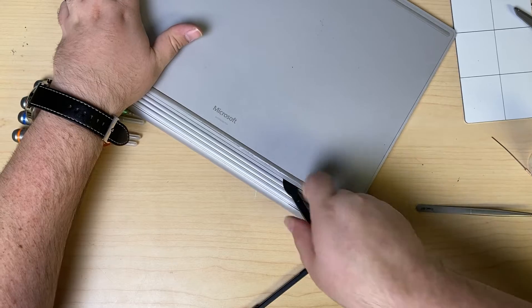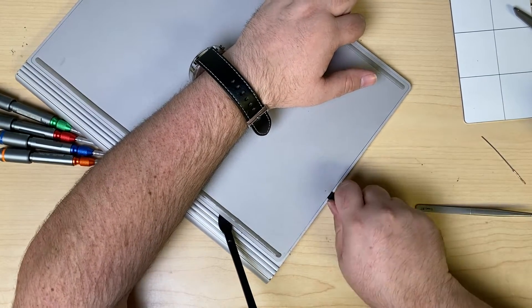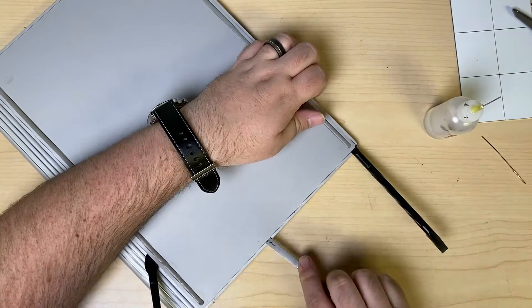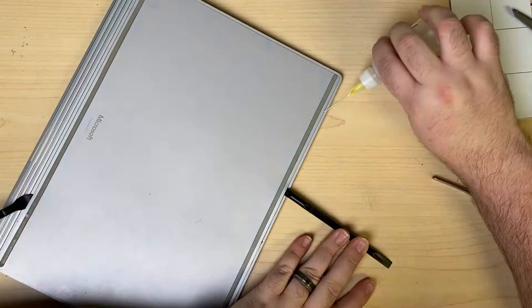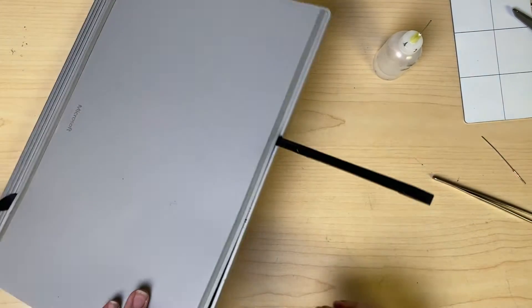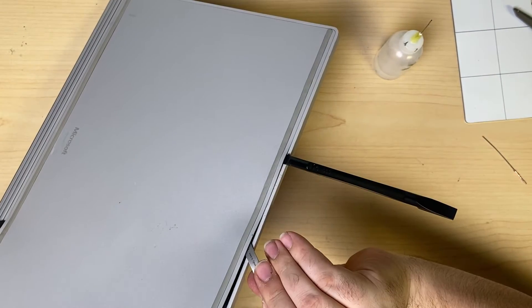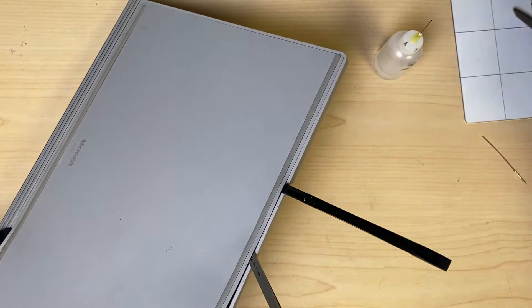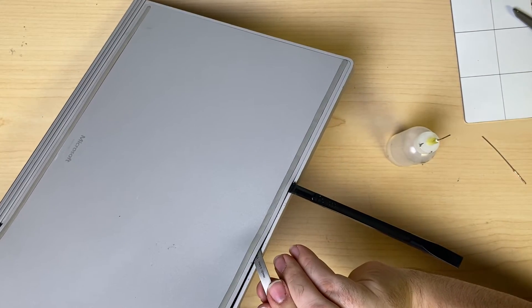It just won't look good when I go to put it back together, so it's obviously something you're going to have to take your time with. There are a couple of thicker spots of adhesive right here that we have to contend with — you can see how it really wants to grab in that area. We can gently but strategically pry deeper in there, adding some isopropyl alcohol along the way to help break up that adhesive.